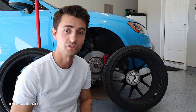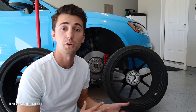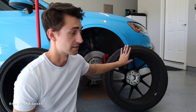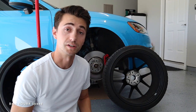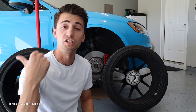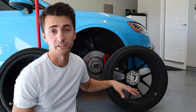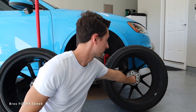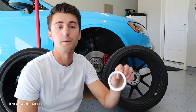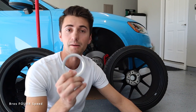If you have a vibration after doing aftermarket wheels, check your hub centric rings and make sure they're solid. When I had the Toyota Supra I had solid polyurethane hub centric rings and never had an issue. On my GTR, the hub of the wheels fits the car perfectly so no rings are needed. But with the Audi, going with a more affordable style wheel, hub centric rings were needed, and I'm really glad I solved the vibration issue with the aluminum ones.